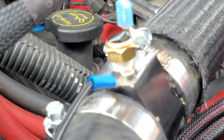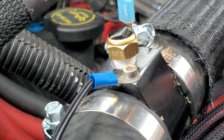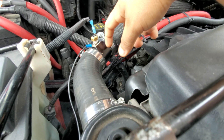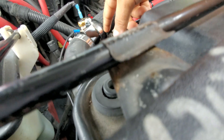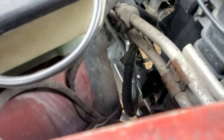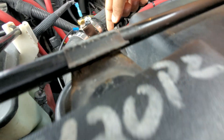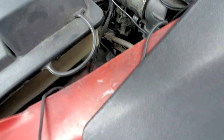I went with the 180°F sensor. I recommend going to O'Reilly's and buying some clamps because the clamps that the housing comes with are too thin, so it was kind of leaking. Also make sure that the cuts are straight on your hose — if you don't cut the hose correctly, it kind of leaks. On one side it was good but the other side I didn't cut it straight.